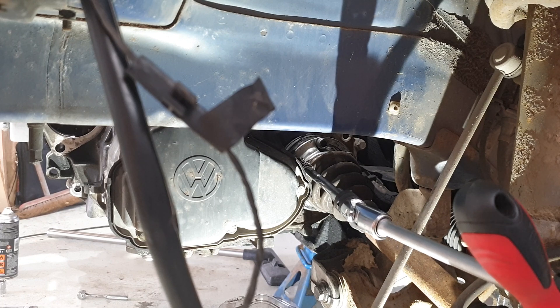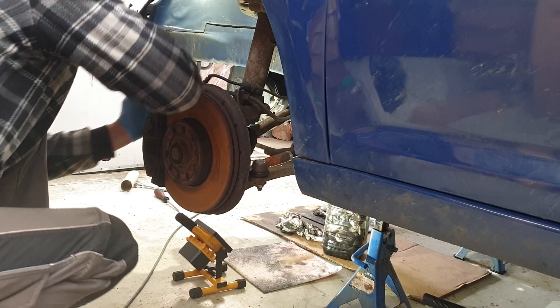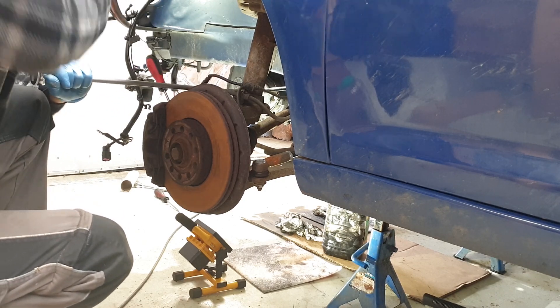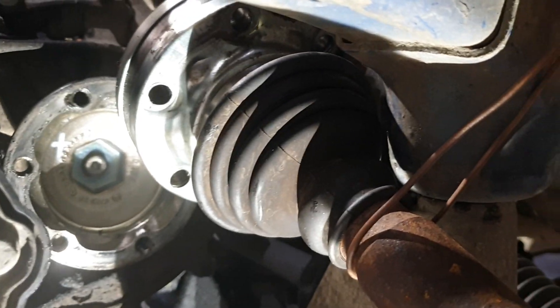That wasn't easy. The shafts are held in place by a number of spline-headed bolts and they're very tight — you can counter-hold the shaft with a screwdriver or something similar in the vents of the disc brake. There is the drive shaft. I've just tied it up with that little wire hanger there.